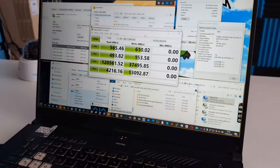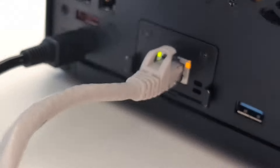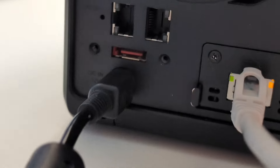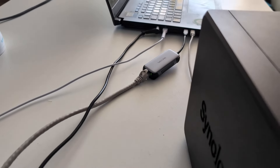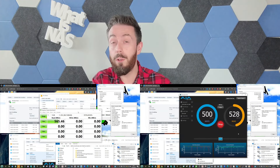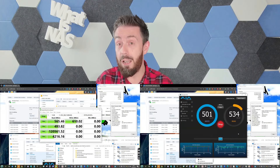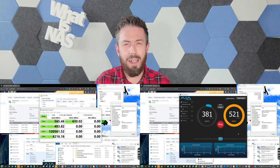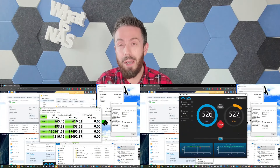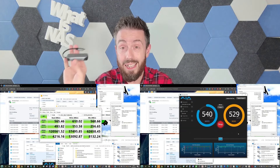We've already run tests with this connected to a Windows system and a Synology NAS. In a RAID made up of SSDs, full saturation was incredibly easy. Remember, 5Gb is not actually 500 MB/s — it's actually a great deal more. In the same way 2.5Gb maxes out at around 279 MB/s, 5Gb is closer to 570 or even 580 MB/s. CrystalDiskMark showed up to 600 MB/s, and ATTO repeated testing of a 1GB file gave consistent performance exceeding 500 MB/s with this adapter on a Windows system.